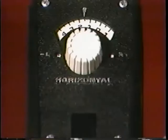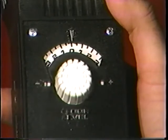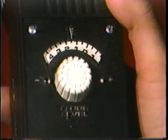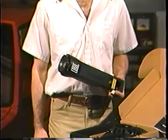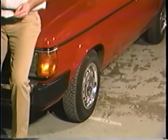Now, looking into the top porthole of Unit A — the one by the rear wheel — turn the horizontal upper knob until the split image is aligned. At this point, you'll have a plus or minus reading on the horizontal dial. Transfer this reading to the floor level dial on each aimer and press the floor level dial inward to set the reading. And that's all there is to it. Remove the owner's calibration fixtures from each aimer and you're ready to do the actual aiming. Remember, if you use the same location each time, the floor slope calibration won't need to be done again.